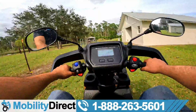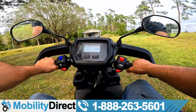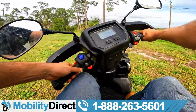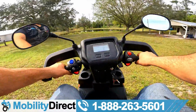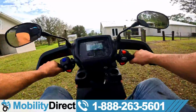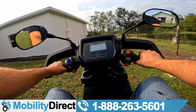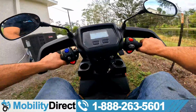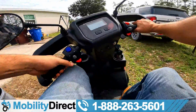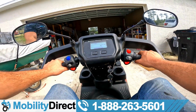Now, if it wasn't just a loose terminal screw like how we experienced in this case, you may need to check all the different wires that lead from the battery to the controller, but the concept will be the same. If you have a loose wire somewhere or a loose connection to a wire somewhere, and you're going around on rough terrain and it's shutting off randomly, it's just one of 2 things. Either your batteries are old and they're not able to hold a minimum voltage of 24 volts when under load, aka when moving, or the error code is exactly correct, meaning you have a loose connection somewhere, folks.